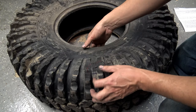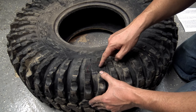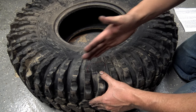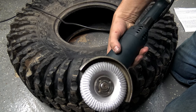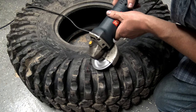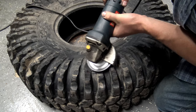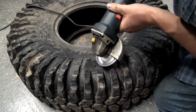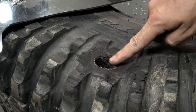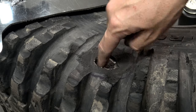The next step — see this cut has got a curve and a little place — so what we're going to do is get rid of any sharp angles on the curve and round them out, so it doesn't have any place to start a new tear. That sucker looks mean. This thing grips like crazy, so I've got to be careful. This is what you want it to look like: kind of a circle. You don't want any sharp edges. You want all this loose stuff cut off that you can.